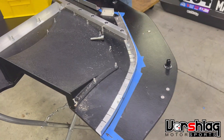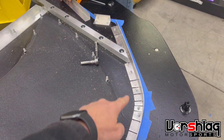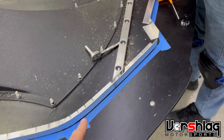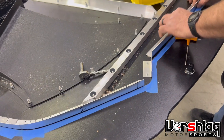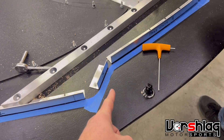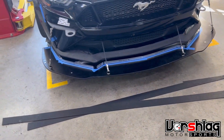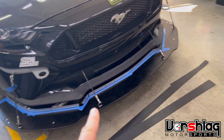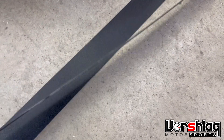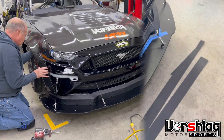Making some good progress here, Brad. So you're bolting these in with countersinks? There were M4 countersinks, little nylocks. And we got a nice little curved edge and he'll build the air dam up from that. We're going to bridge a couple of these gaps with just the plastic itself. Brad's got the lower aluminum piece fitted all the way around and he's cut these strips of this ABS plastic, which will cover that gap. We'll show that here in a minute.